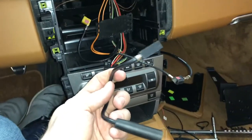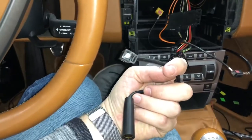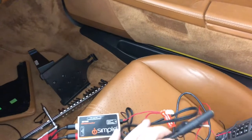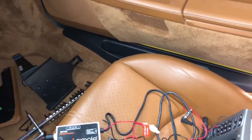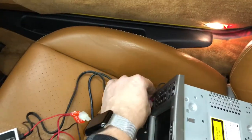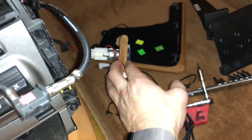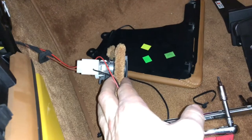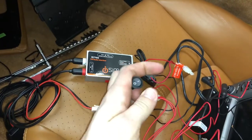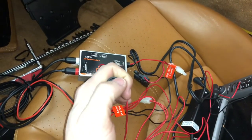This will require some European car antenna adapters, which I luckily already had from the previous installation. I'm going to plug the antennas into the in and out ports, then hook up the switch, which has a black and a red wire. I already had the old module tied in down here, so that's where I'm going to tie in for the test.